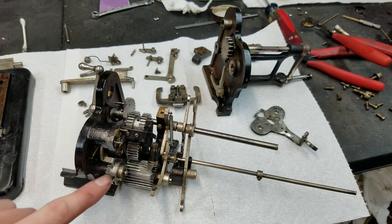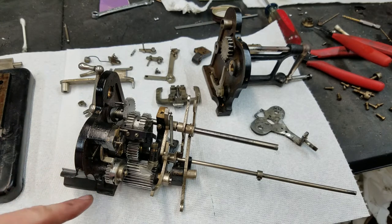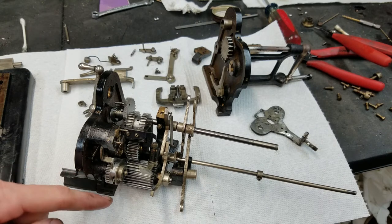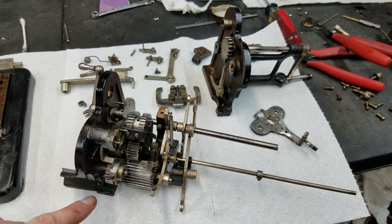The issue with that is, in order for the counter carry to work properly, it's like ripple carry, right? The carry has to propagate from the digit that's being incremented all the way across the other digits as needed. Like if you had a 9 in this column and the finger increments it, that's going to carry over to a 10. So you need to increment and then propagate the carry to the next digit. And if you had all 9s, you'd have to increment and then propagate in sequence all the way along. So in the fixed finger scenario, if you turn the crank handle one way, it's fine. It increments right away and then has time to propagate all the way across.